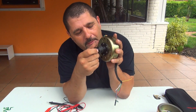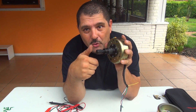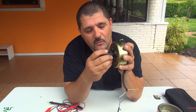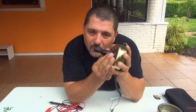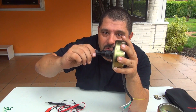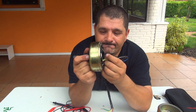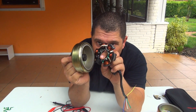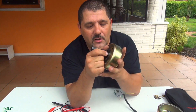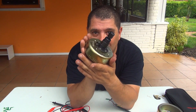You place this puller right here and make sure you turn left with this part. You screw in left — not right, left. When you feel it doesn't go in anymore, turn a little harder and make sure it's nice and tight. At this point you screw in this part turning right, and this will pull out the flywheel so you're going to see the stator. Without this puller you cannot do it — you need it to remove your flywheel.